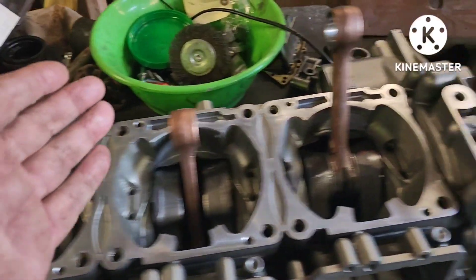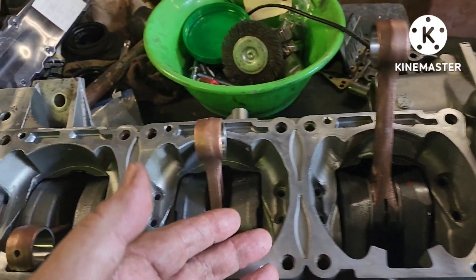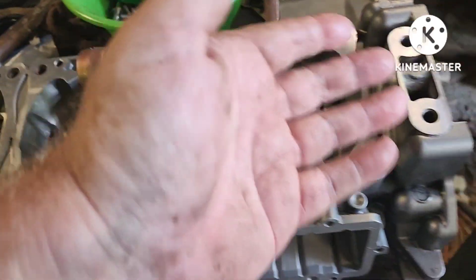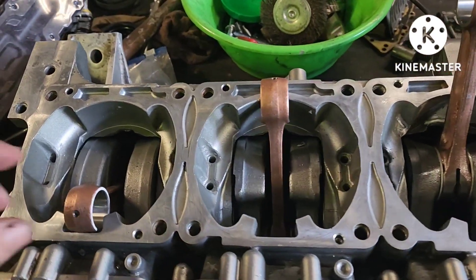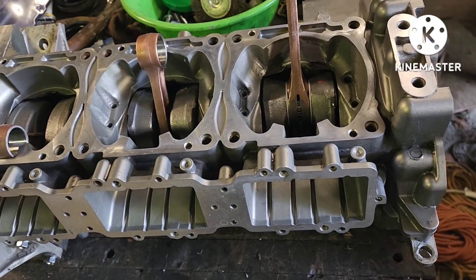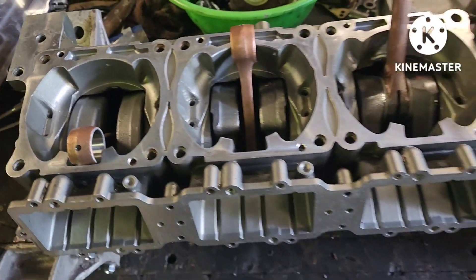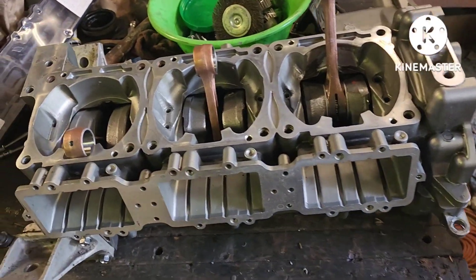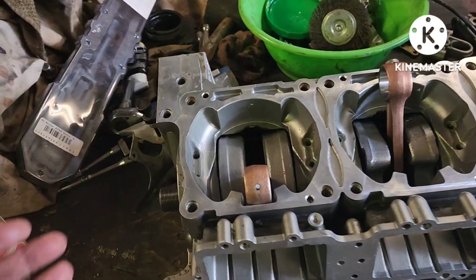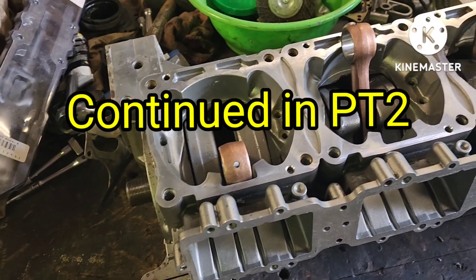When I build these, I go ahead and clean all my machine surfaces again with some acetone. These are just some gaskets that are going to go in there. I prefer the metal gasket kits — the cheap gasket sets, you'll see they're only 60-something dollars, well they're $60 because they come with paper gaskets. I had one of those tear up on a Kawasaki build and I haven't bought paper gaskets since. So I stick with the little bit better quality gasket sets if I can. So let's go ahead and get my pistons out — I've got all three new pistons. I could have reused two, but I was going to have one brand new piston and two used pistons. So I've got two good GP1300R pistons for maybe a future build or to sell.